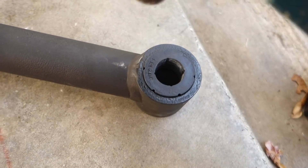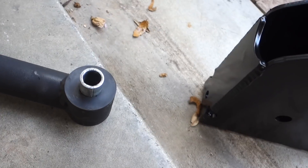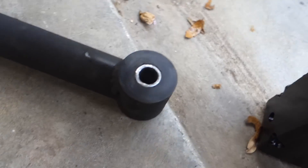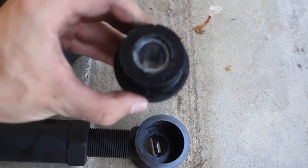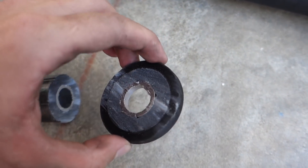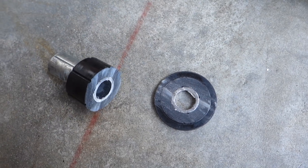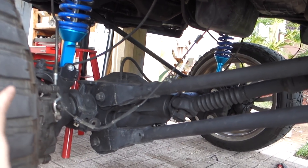We can just give that a tap in there. Hammer this in here. Now if we flip it like this, it looks a little funny, but this should fit quite perfectly. Boom — problem solved. I just went ahead and popped this one out of the lower arm and we're going to do the same exact thing to this. Since I'm cutting the same amount off of each of these, I literally just put the bushing on the sleeve and cut it off with a saw. It was super easy — like, stupid easy. Okay, so we got one side in. Everything's just there loosely right now.